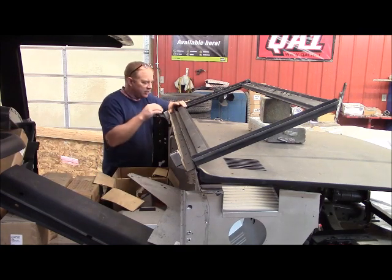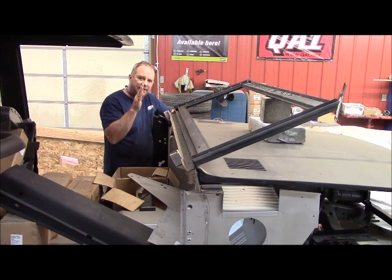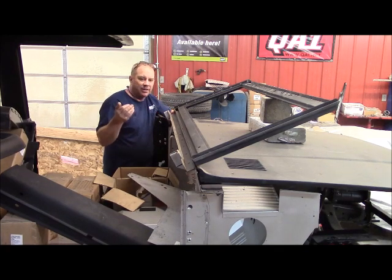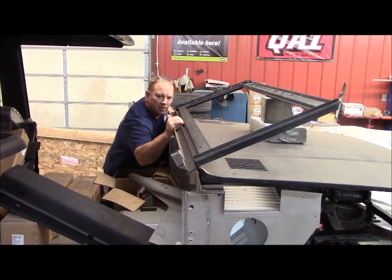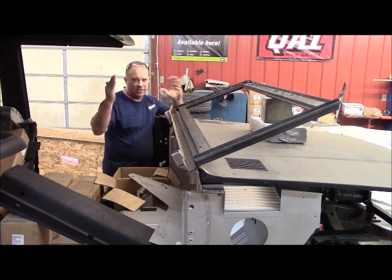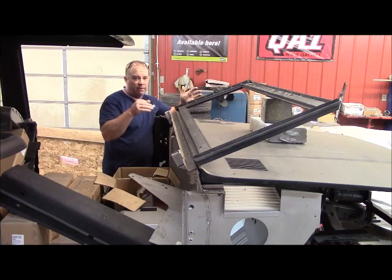I've got to have the hinge out enough so it doesn't touch, and it needs to be the same distance out in relationship to the window frame so the two are on the exact same line. But with this little bit of arch in there, it's going to make the hinge go out further, so I've got to take that out. I can just pull it in with my hand and pull that dash up. I'm going to go ahead and center and drill their 5/16 holes all the way down through there and completely install them, because all it needs to do is sit in the center. The hinge needs to be in the proper location, and then once it's done I can use it as a reference point.